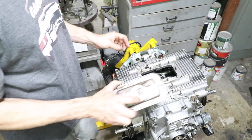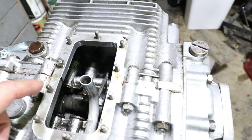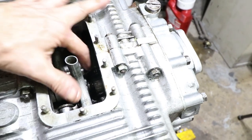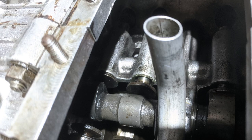Inside here is where it starts to get a little sketchy. The sump cover has been removed, and inside it doesn't look particularly clean — if I was rebuilding this engine I would have it sparkling inside, but there's some old dinginess to the aluminum. The one thing that does have me concerned is the cam right here: it has some assembly lube on it, but that lube has gotten really stiff and dry. Assembly lube is normally a good thing on a new engine, especially on the camshaft, to break in the new lifters with the new cam. In this case I'm a little worried about the condition of the assembly lube, and they probably used the same assembly lube on the crankshaft and the cam bearings.